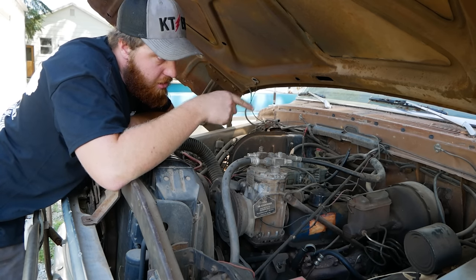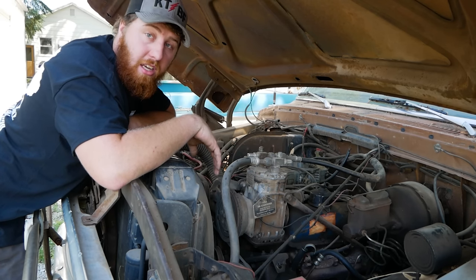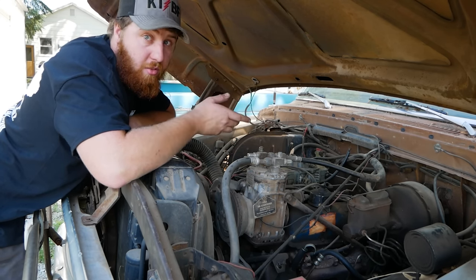This one I did see has a bunch of grease packed up inside one of the wheels over there. So the O-ring on the end of the floating axle probably leaks and needs replaced. So I should probably check that fluid level before I even leave here.